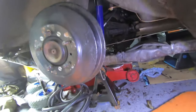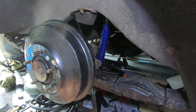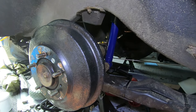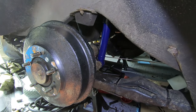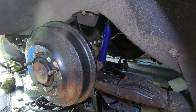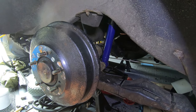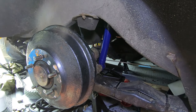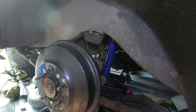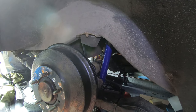If we have a quick look under the car, you can just about see the bottom of the shock absorber. I mounted the adjuster to the rear - I thought it's probably better to keep it out of muck coming under the car. I set it to the middle setting. I think there were 36 clicks, so I've set it to 18. I'll do the same on the other side. It looks like I've painted them to match the car bodywork, but I haven't - that's the color they come. I'll do the other side when I turn the car around.